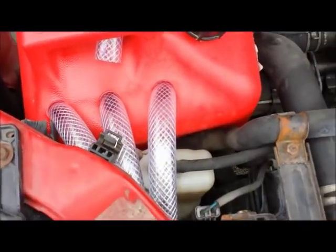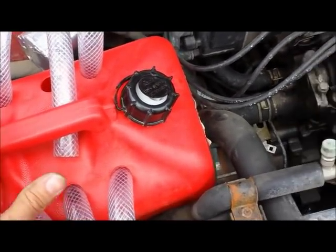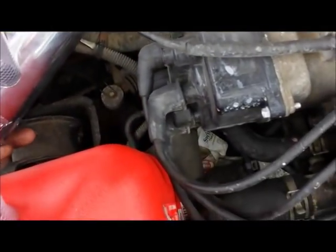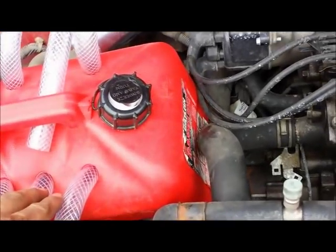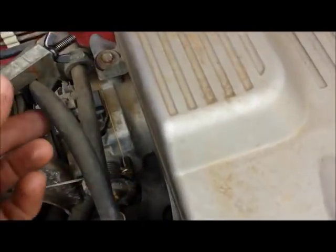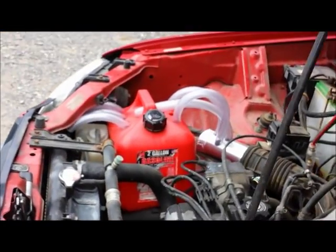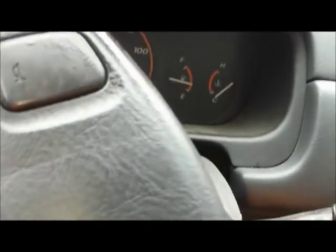Finished project — I ended up pulling these back up out of the fuel. Here's the deal: this would probably work way better on a carbureted setup than fuel injection. Getting the air-fuel ratios right with all the sensors is being a pain. Right now I found that having two hoses drawing vapor and three pulled up out of the gas — just sucking air across the top of the gas surface with the other side sealed — is giving me the best drivability. I've pinched the fuel line completely shut, so there's no fuel getting into the fuel rail. It's one of those things where you tinker, adjust the number of hoses, but I'll tell you what — it fires up, it runs and drives, and it's running just off the vapor in the top of that tank. That should give me phenomenal gas mileage if I can get it dialed in.